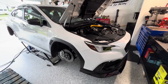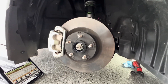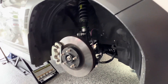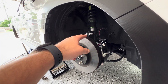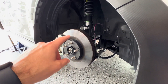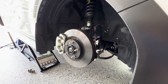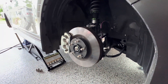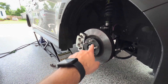With everything drained and the wheels off, next we're going to work on getting this axle taken off. It's the same 32mm nut for the axle right there. We're going to disconnect the strut — probably not the end link — but we are going to mark the top bolt since it's a camber bolt. I want to make sure we put it in the same way, marking it on both the strut and the bolt so we don't need an alignment afterwards.